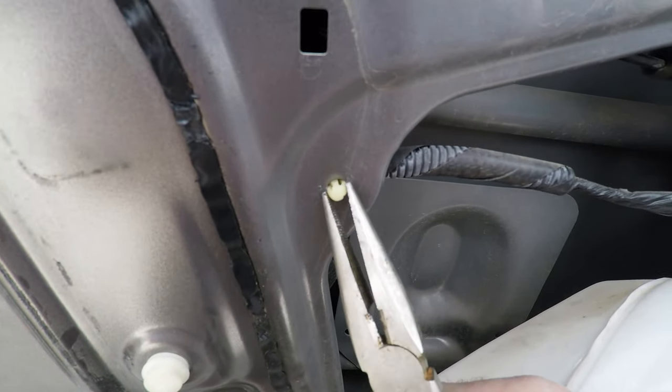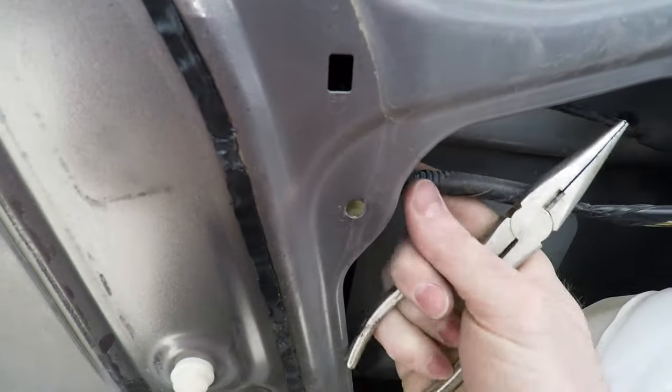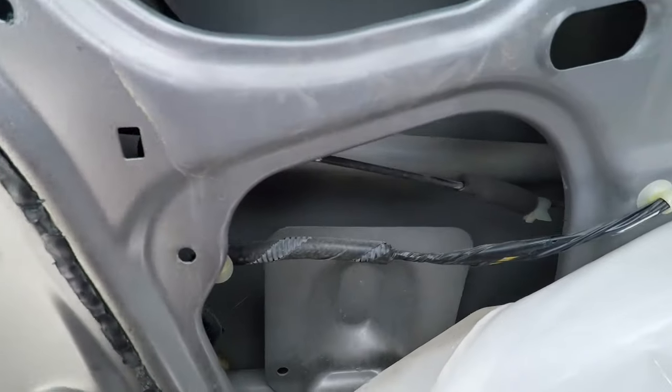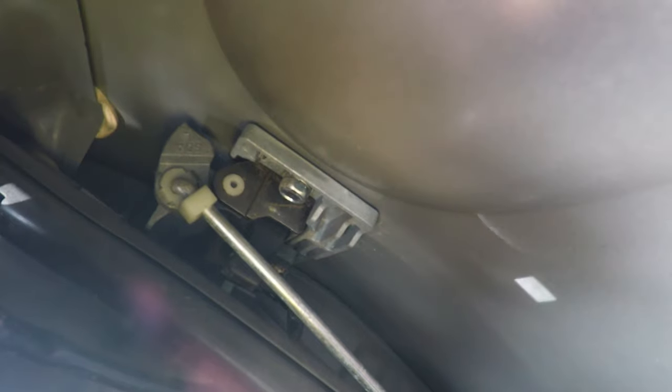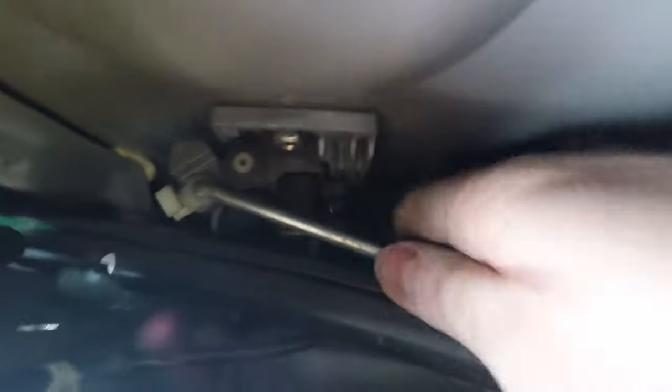Here's the back side of a push pin that needs to be removed — just squeeze the two pieces together to let it slip through the metal hole. Now inside the door there's a rod being held by a plastic keeper like on the cable for the door handle. That'll just need to be unsnapped and the rod can be pulled out. There's also a second rod behind this one that I wasn't able to capture on the video, but it will be disconnected and removed the same way.